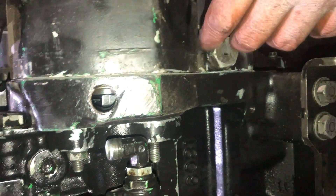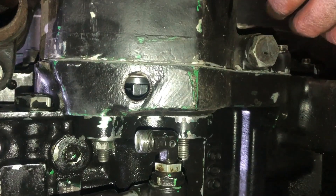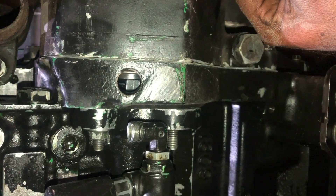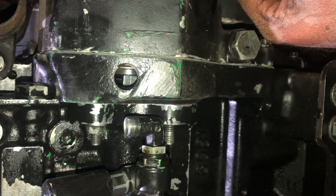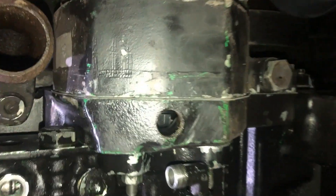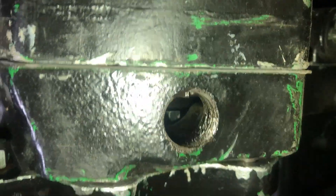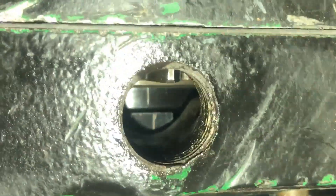There you can see from the inspection hole — we place the pump on the engine block. There are four studs. These two points are perfectly aligned, and when we move our drive hub the timing will be out. There you can see their alignment is a little bit out.